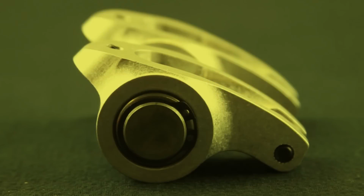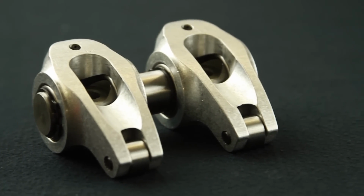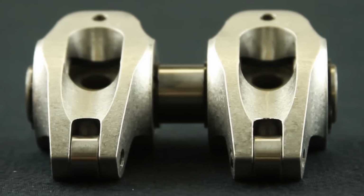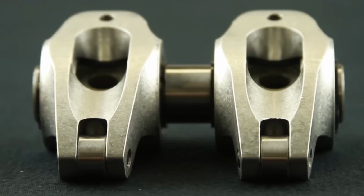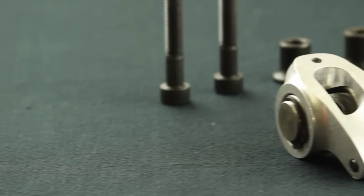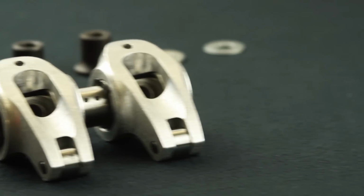The rocker arms have 11/16" trunnions, among the largest available. They feature Torrington bearings and tout the lightest nose wheels in the industry. The nose wheel axle is retained by an internal circlip to prevent accidental disengagement, an all too common occurrence in competitive rocker arms. The Yella Terra Ultralite roller rocker arm is an easy fit product, providing simple installation.